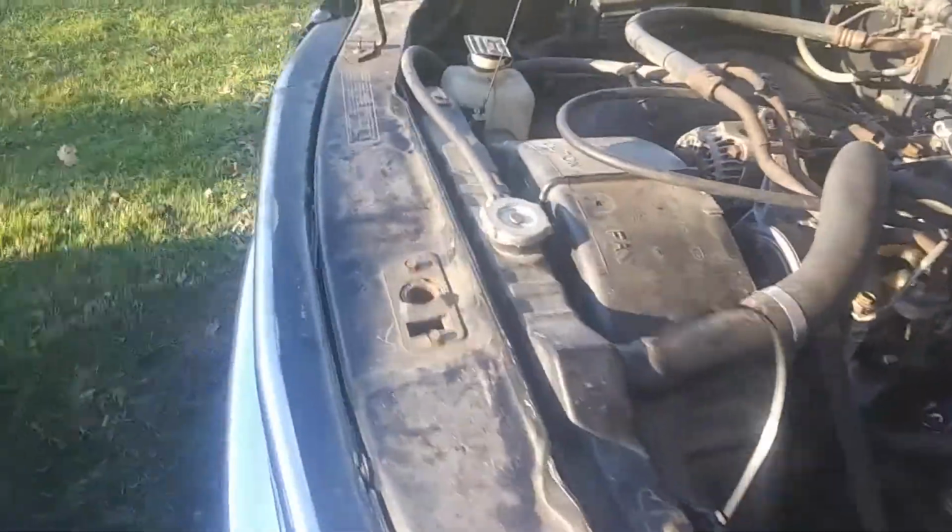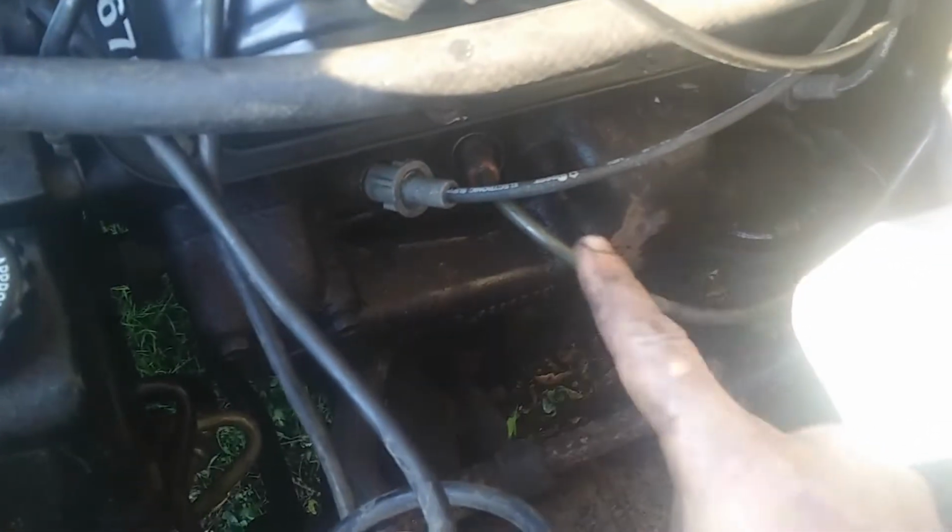So, what's going on? Well, get out of the old dirge here. I come in, look over here, everything's right. And I look up here, everything's right. And then I look down here. Fucking spark plug wires. Fucking dingly dangling down here. Not even plugged in. Not a single one of the three on this side. So I plugged them in. Come back over. I'm like, alright.